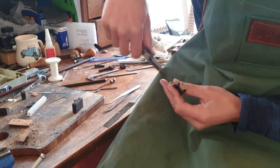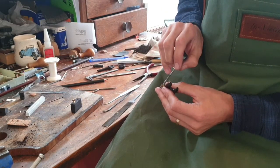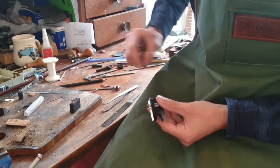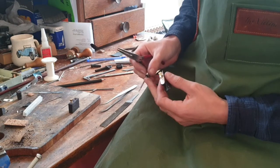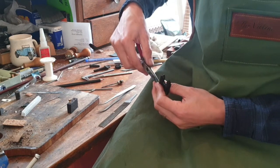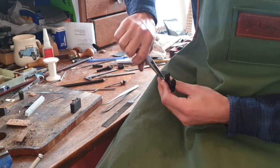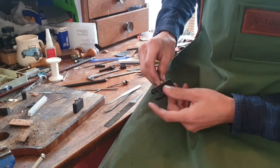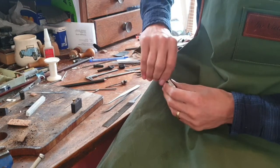You notice at no point do we use the adjuster through the hole to turn it. A couple of reasons: you risk damaging the edge of the liner with the through screw threads. The other reason is you risk damaging the three internal threads on the eyelet. Maybe being very cautious, but it's all about good practice.